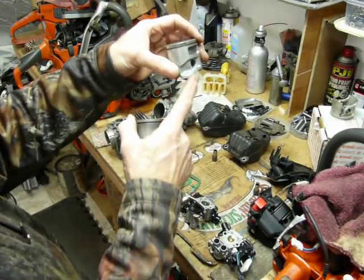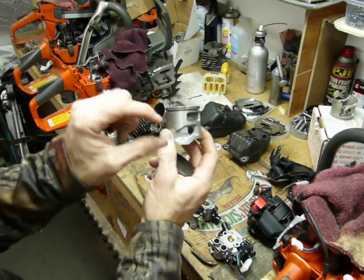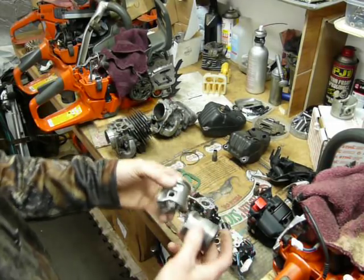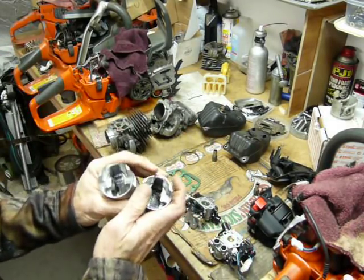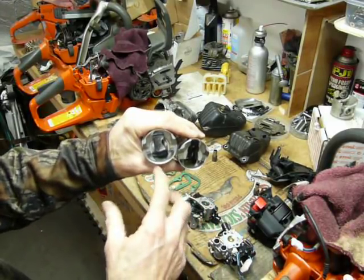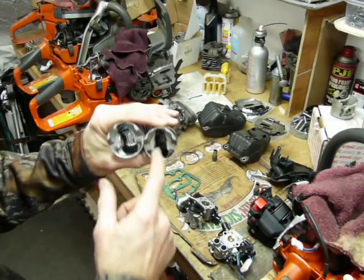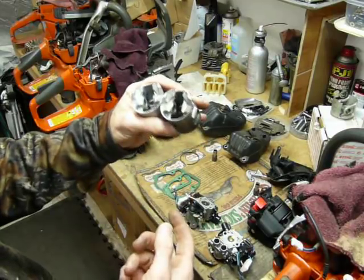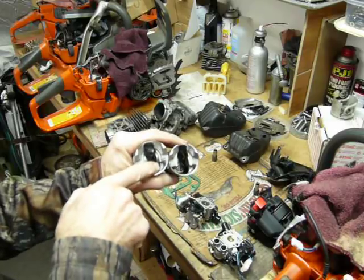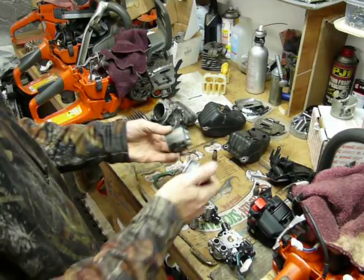Then it closes off the circuit for the fresh air that comes in, and it's trying to essentially stuff it into the end of the transfer port circuits. Interesting concept. If we look underneath, we can see there's a lot of area right here where we can actually be pushing the charge to pressurize the crankcase. They have these little gussets in both of them. You're not going to get as much flow coming out from underneath the dome as fast. Might end up helping them cool a little bit, but you can see we have little flat spots there where we actually can push the charge, which I thought was interesting.